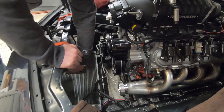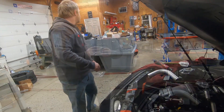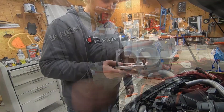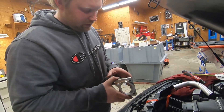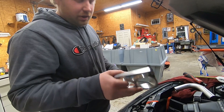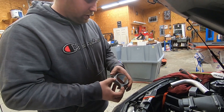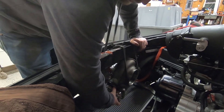We'll be able to just run the pipes right over and hopefully make this pretty easy. One thing to make this really easy is we got this Parker Speed — it's a twin scroll flange, but it's not a twin scroll housing, which doesn't matter. This is from Parker Speed; we got it from Direct Performance Solutions, and that'll just make our pipes come up there nice. It's threaded, slide it right in there.